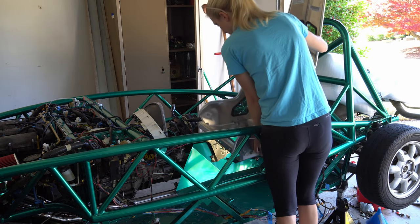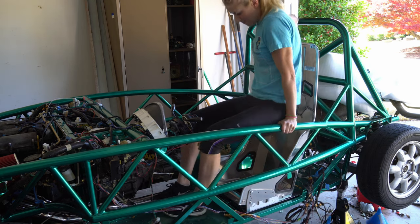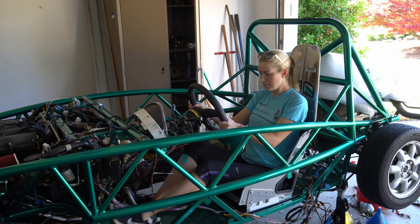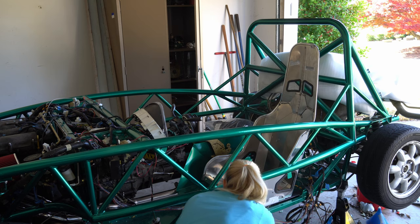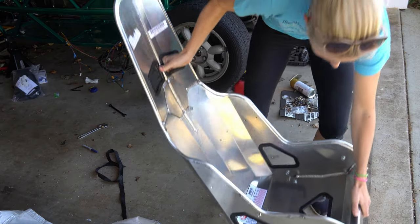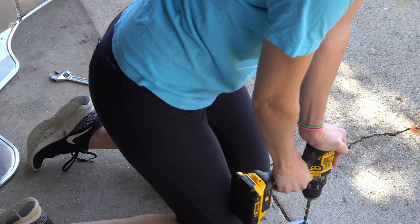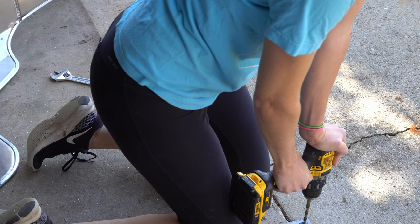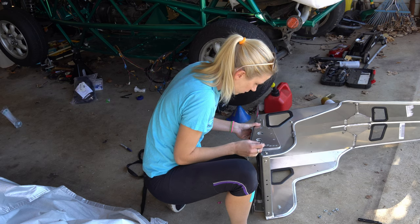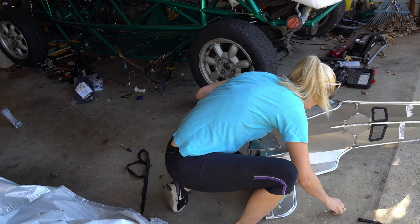With the plan laid out, it was time to test the fitment again. I want to see exactly where I'm going to be sitting in relation to my pedal assembly so I know I'm comfortable while driving. The goal is to see exactly where I want the holes to be in the flat bar stock so I know they'll overlay along the square tube in the chassis. Once I was comfortable with the seat position I marked the flat bar stock, making sure the marks were directly over the center of the square tube. With drilling locations marked, I removed the seat and the side brackets to get clearance to drill. I drilled out all three holes — two going to the square tubes in the chassis and the third going to the side mounting bracket of the Kirkey seat. In retrospect I went the long way about this with another test fit, but I definitely wanted to be sure and didn't want to drill any more than I had to.